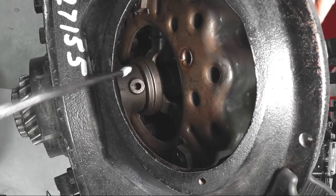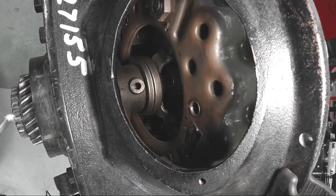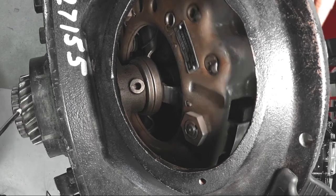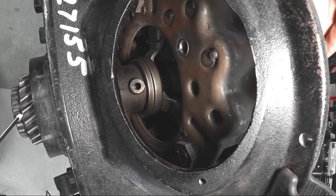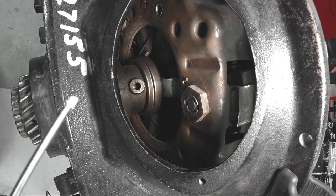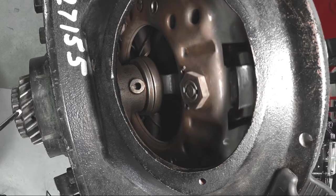As I rotate this flywheel, we should see that my output shaft — really it would be the input shaft of the transmission, the output of the clutch — is actually rotating. That's because this is a spring-applied clutch. A spring-applied clutch holds torque delivery through the clutch disc to the input shaft of the transmission when my foot is off the clutch pedal.